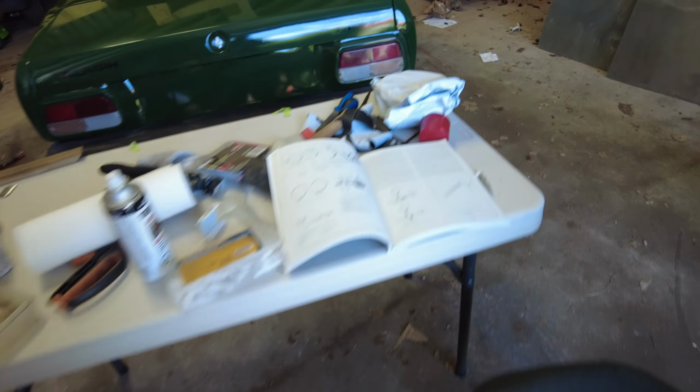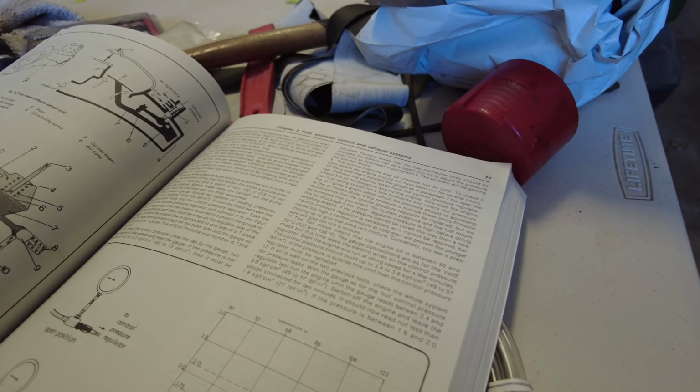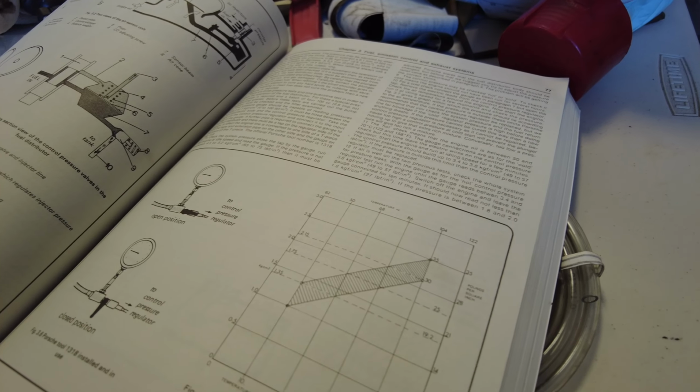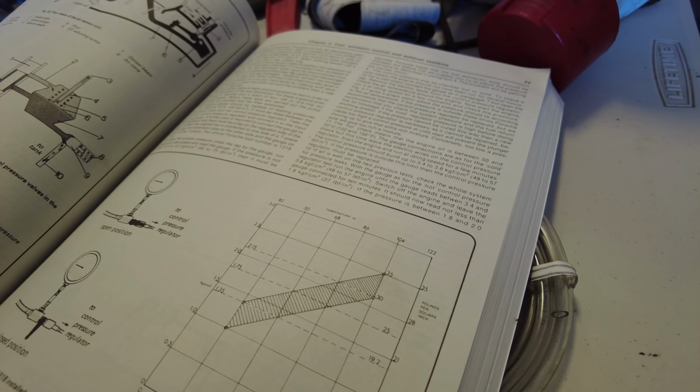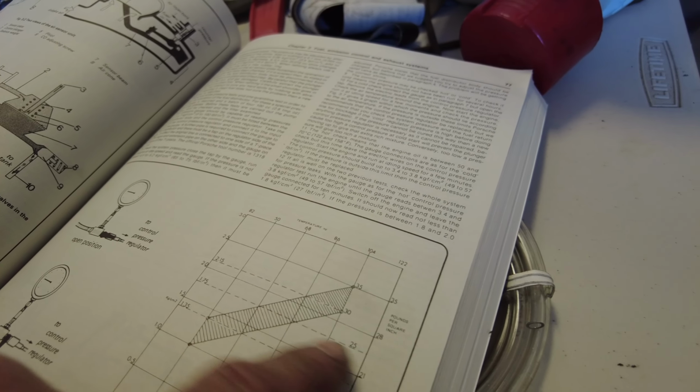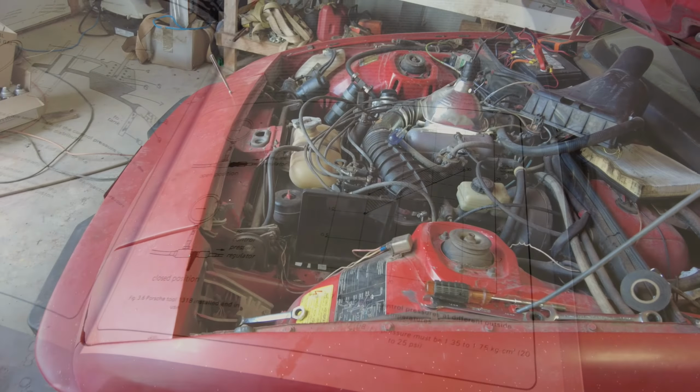The book says between 14 and 30 or 35 is acceptable control pressure at different outside temperatures, right? So the temperature outside is 30 degrees. We're going to say 20 degrees. So we're okay. It's got enough pressure. So the next thing I'll do now is pull the injectors out and see if there's fuel coming out of the injector. Yeah, so I don't think I filmed that little episode.